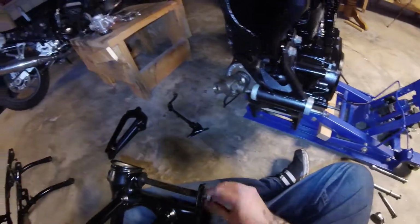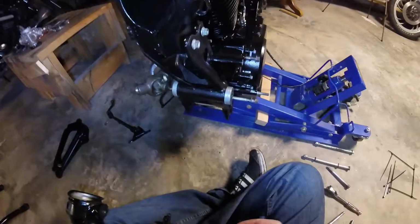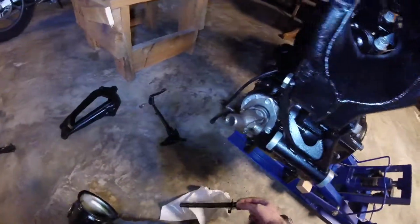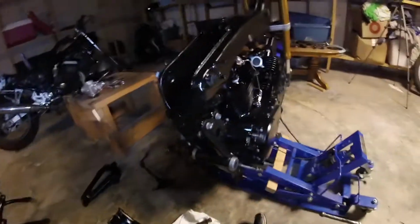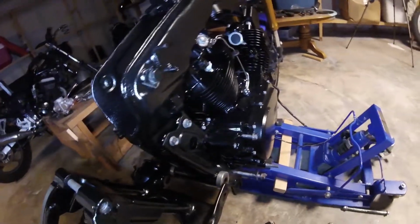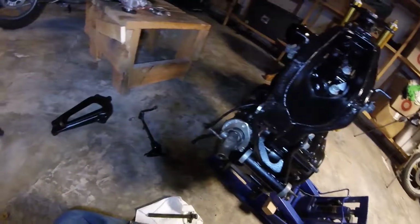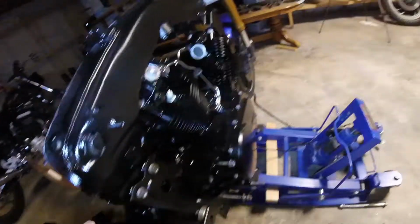So I guess first things first, we'll see how this mounts up, right? And essentially we just take this pin out, and it's going to slide in right through there. Pretty simple stuff. As you can see, this one's still pretty well greased. Actually, we still got a lot of grease on there, so that's good. So this guy is going to go kind of over this. The axle shaft will slide in there when we're ready. Actually, before we put this on, I'm going to pop this out, because this is how we'll align that thing. Go ahead and slide her on in there.